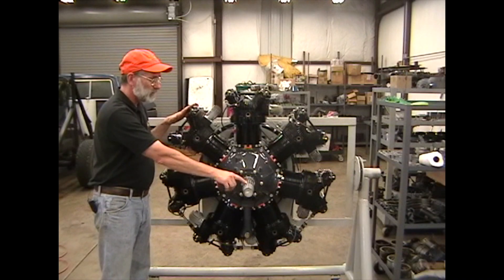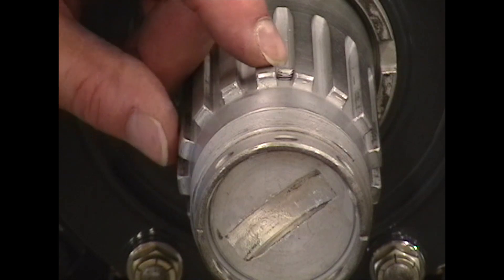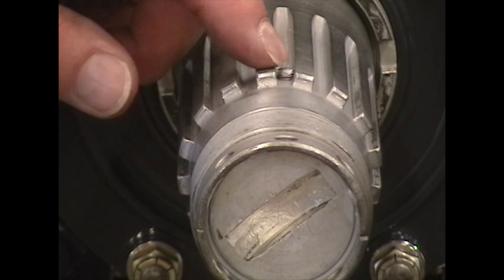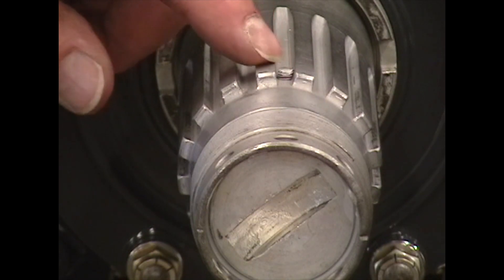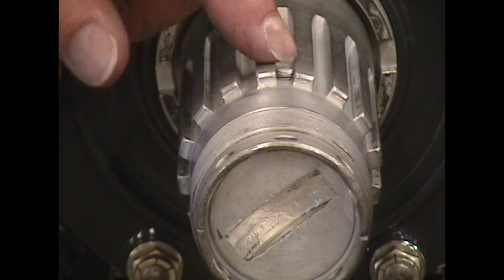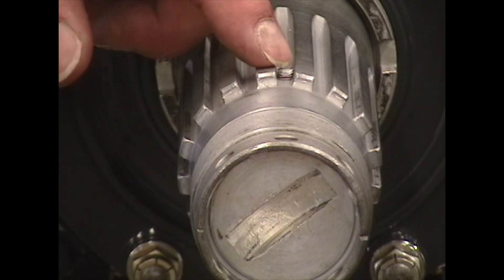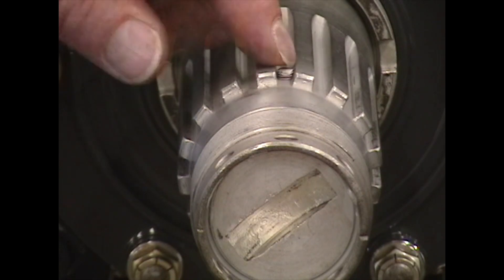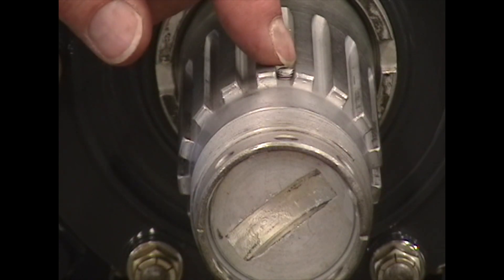Let's zoom in on that pin so you can see what it looks like. You can see our blind spline better here — it actually is a little screw. Because it's a screw, it's possible to remove it, but if you do that you'll no longer have a good way to index the propeller and you won't really know where you're at. So it's important to have that screw in there. When the propeller goes on, the blind spline on the propeller hub will be indexed with that little screw, and that screw will always point towards the piston that is at top dead center.